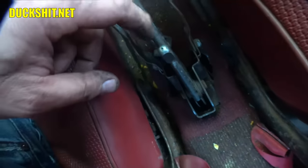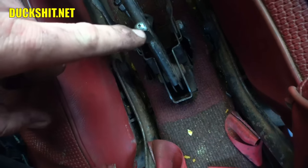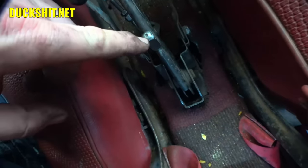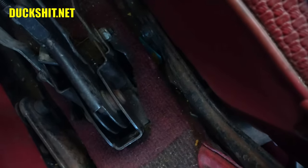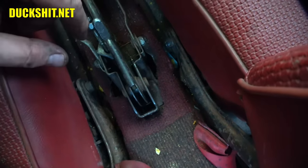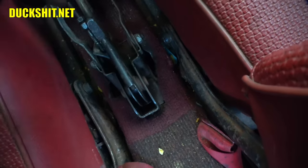Anyway, I'm going to snag it. Here's the balance beam and the other cable, so these are ready to go. I just got to pull the cable through the hole on the other side and stretch it over the top. The little pin on the top here is broken off, which is very typical on later model Volkswagens, but it doesn't seem to matter as long as you keep the cable snug — though it's probably one of the reasons why I had no e-brake. Next time I get around to pulling this handle out, I'll drill it out and put a proper hardened steel insert that won't break off so easily.